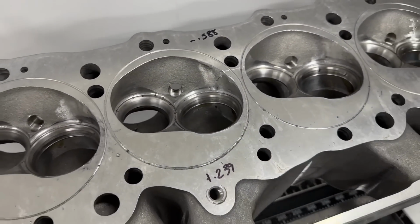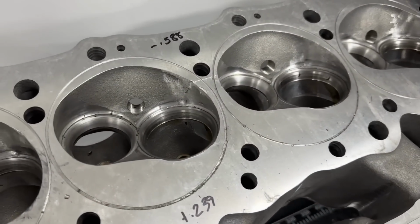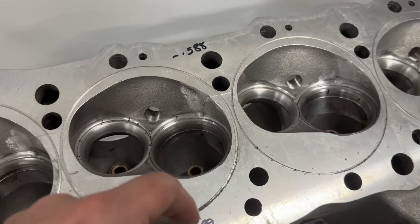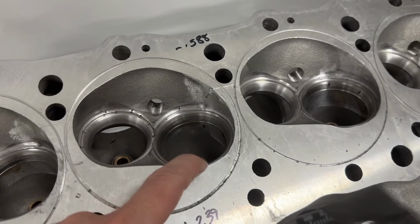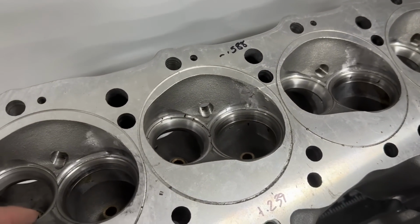The only time you might say, why do they even have this material? You know why they use Stellite? It's for like natural gas deals. Because when you have gasoline, E85 or something, any of the fuels, they provide some lubrication between the seat and the valve. A natural gas deal does not, period. So what it does is it actually eats up the seats, and so they made the seats harder for these Stellite ones. But there's other ones you could have used, like the Killer Bees.